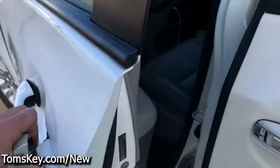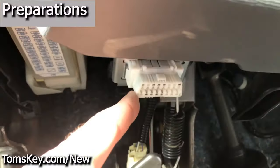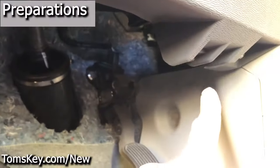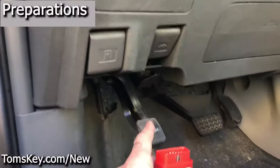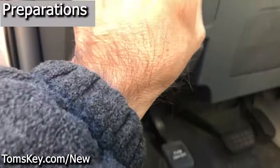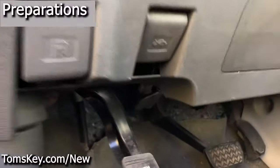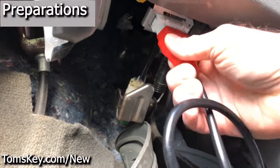Let's get in the car and do this. First, you're going to plug in the extension cable. Look down here — you're going to find an OBD-II port just like this. They're usually wide. On some vehicles it's over near the center, on some it's around this area, and sometimes there's even a panel or a little piece of plastic you've got to remove. Take the supplied extension cable, line it up, and plug it in.